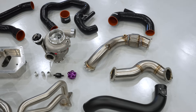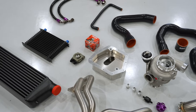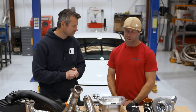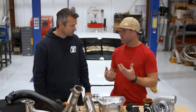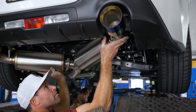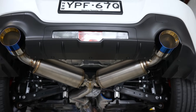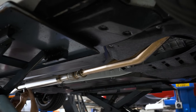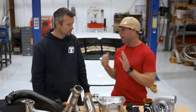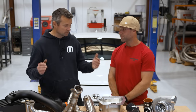Are there any optional extras — can I spend some more money? With turbocharging you're trying to limit back pressure, so we provide open pipes, front pipes, and cat-back exhaust systems. The factory exhaust is two-inch, which is pretty tiny. The 2.4-litre is like two-and-a-quarter, a little bit better. We go two-and-a-half, 2.75, even three-inch options for the cat-back. With the turbo setup, oil temperatures often get a little hotter because you're running the engine harder.